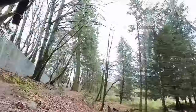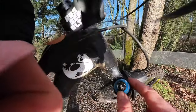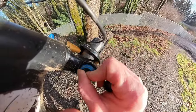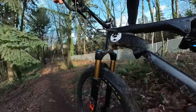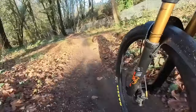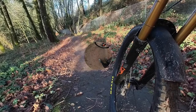Let's explain compression — I don't really care about suspension theorists; everyone has a different theory. Here's the dummy approach: you need to understand how it feels, that's all. Take the top cap and crank it all the way clockwise — it'll be about 14 or 16 clicks of low speed compression. Go to a steep section of trail and go down it slowly, paying attention to how it feels. Repeat the process with a fully open low speed compression knob and you will basically understand compression. If you add too much compression for your weight, it will feel like the fork is choked up. My dummy answer: I turn five clicks of low speed compression on every single fork I ride and then never touch it again.